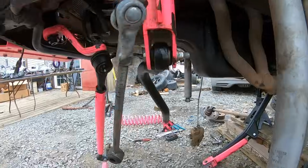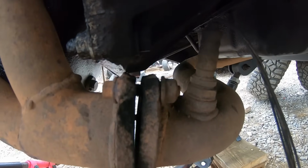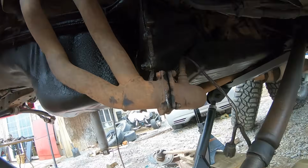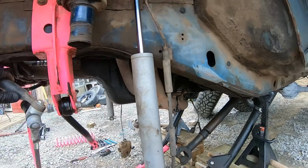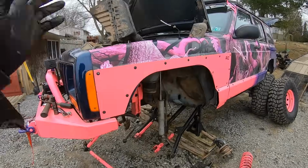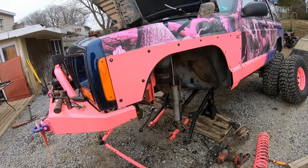Other thing, the exhaust. I'm gonna have to get an exhaust gasket because you can definitely see right through that, and that sound annoys me. I did look up through, nothing else appears to be cracked or anything, so we'll probably just go ahead and get a new flange for there and get this thing tossed back together. While it's apart, do it all right the first time, rather than the typical me. I would put it all back together and take it back apart, put it back together, take it apart. Just gonna do it once and be done. So time lapse it is.